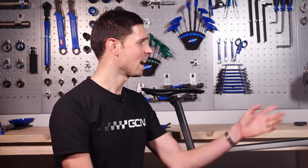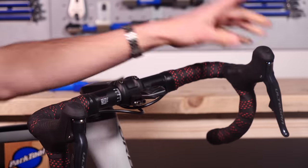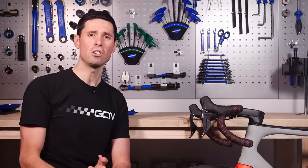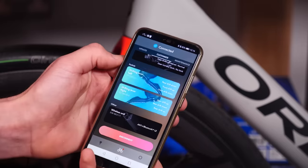There are a host of other features you've got access to. One of my favorites is the additional little buttons on the top of the levers — that's something many people are not aware of, so it's quite a cool feature to make use of. My favorite thing is to set these shift buttons up to actuate the rear derailleur, but you can also assign these buttons to operate your Wahoo head unit, which we should dive in and look at next. To make use of these hidden buttons on the top, we're going to open up the eTube app and go into both the left and right shifter to assign the buttons to whatever job we want them to do.